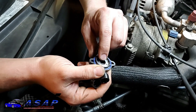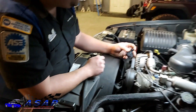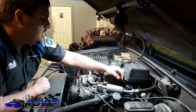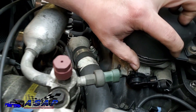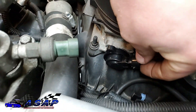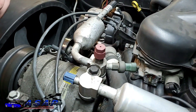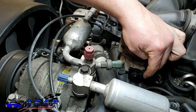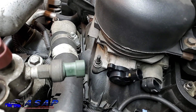You just have to make sure you line up that bevel part with the throttle in the rest position. Let it just kind of fall on there and let it find its spot. You'll notice I just set it on there but my screw holes don't line up — don't go trying to jam this thing on. This thing's got a little tip right here that's going to fit right in there. We're going to slide it on just enough, let it find itself, then clock it back a little bit and slide it on the rest of the way. If you don't pay attention to that, you're going to end up breaking the sensor right away and you've got to buy a new one.